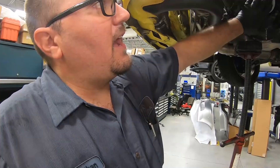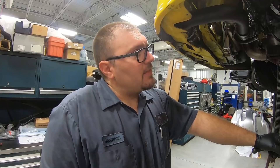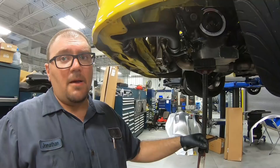We got the ATI dampener back on. It is a little bit tricky — the kit we had didn't come with the exact right attachment for the crankshaft, so I'll have to order that, but we were able to work it in there with the wrench. Everything is on. Next step, we're going to put the alternator belt on, then put the upper covers on, valve cover on, and fire this thing up and make sure we've repaired the noise.